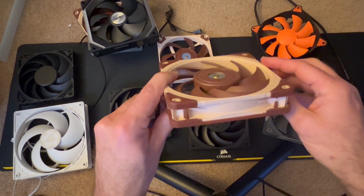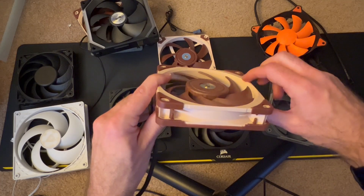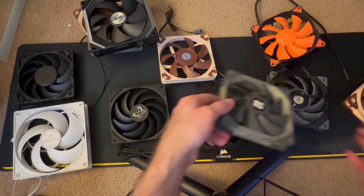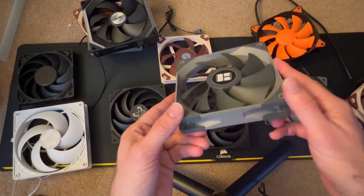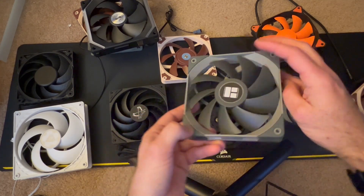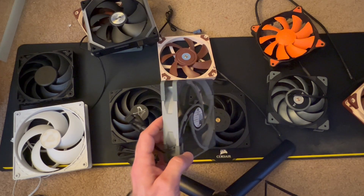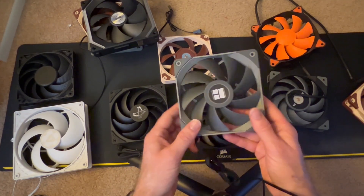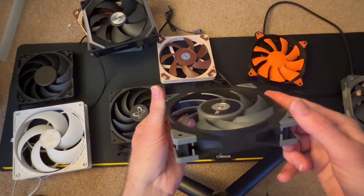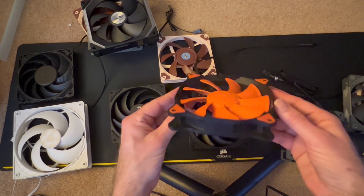Looking at the silent fans, there's quite a lot of space between the blades and the front of the fan housing, which is why these can go right up against a radiator or heat sink and be more or less completely silent. The Thermal Right C12 blades do get close to the edge at the tip, but the C12 Pro was only spinning at 1,900 RPM and was basically silent. The Thermaltake Tough Fan was surprising — I guess blade shape matters because it gets really close to the front edge, yet the Cougar CFV12HP was also completely silent with a good amount of space to the front.